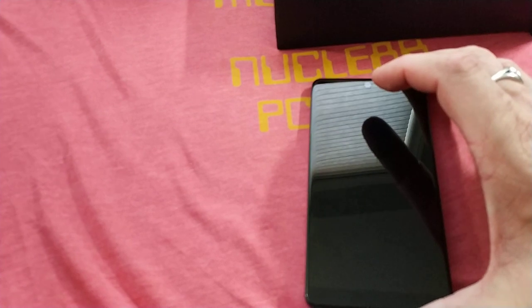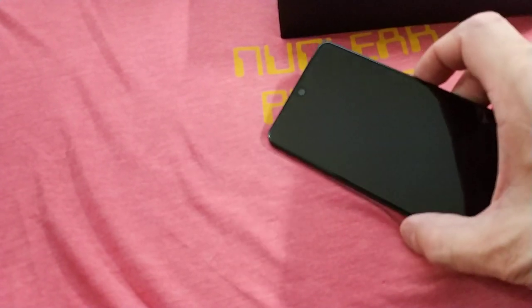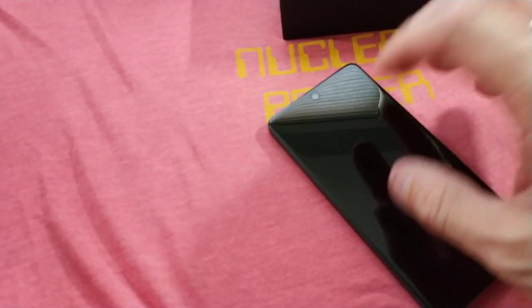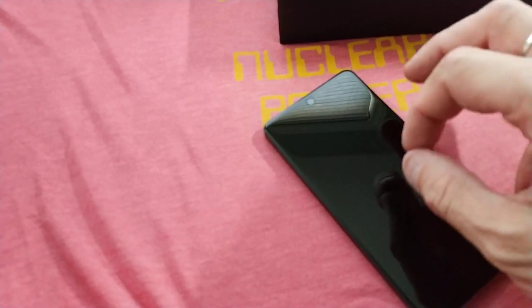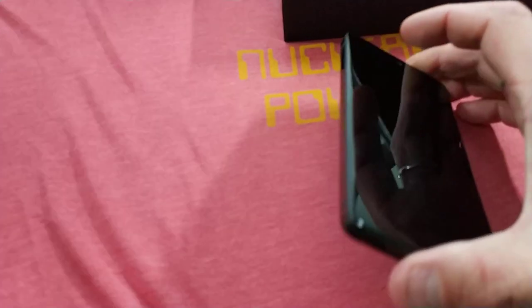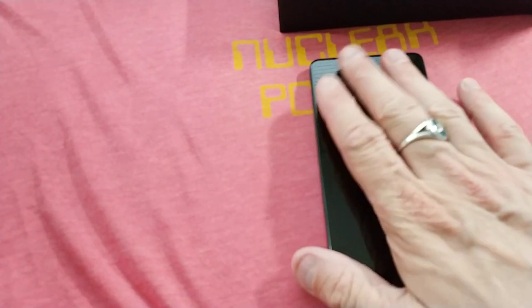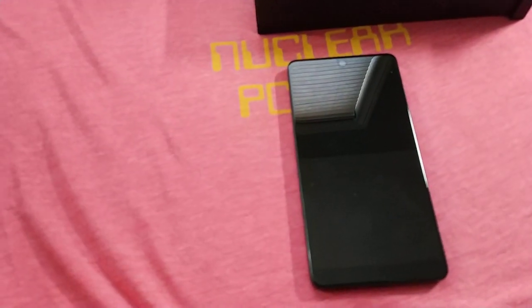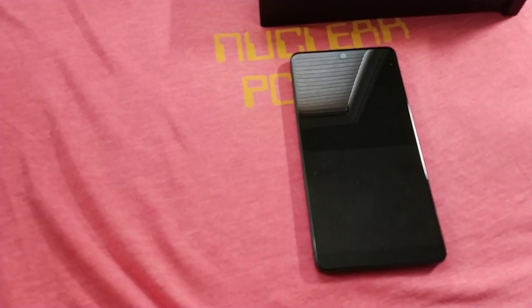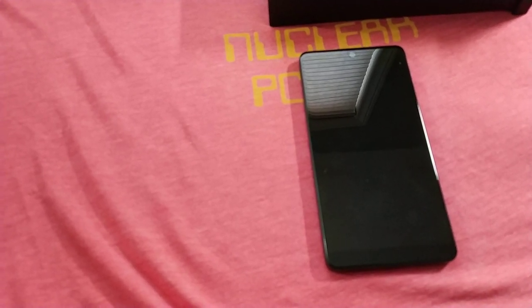Somebody posted a score of 205,000. When I run the benchmarks, it's about 150,000. That's a huge difference, and I get about 100,000 just stock out of the box. I have to go into developer options and put the animations at 0.5 to get a higher score. It shouldn't be getting 100,000 with the Snapdragon 835 and 4 gigs of RAM — it should get a higher score. It's obviously doing some throttling. It does get warm, so I have a feeling that is the source of the problem. It's not so much that it's not a capable chipset or that they're lying about the specifications.